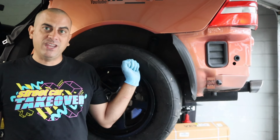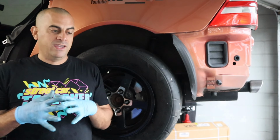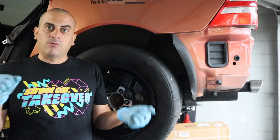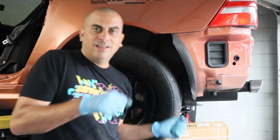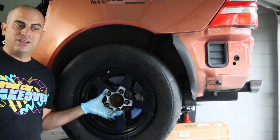Now, also with the 15-inch wheel, I have a lot more sidewall. So if I want to drop pressure, I could get a much bigger footprint. That's good and bad. If I want to start going around corners, I kind of want a 17-inch rim. But I think these look pretty good.